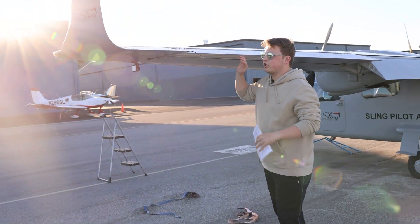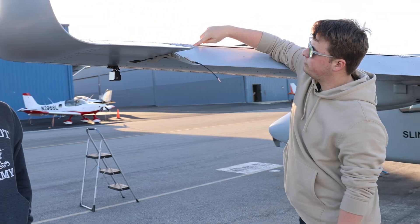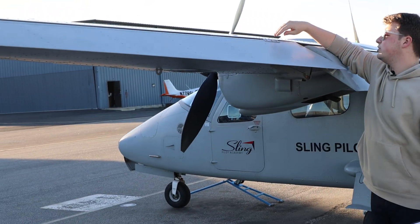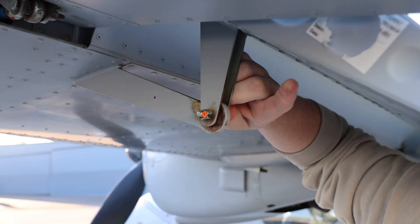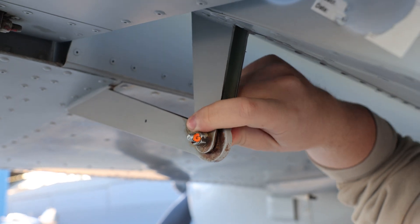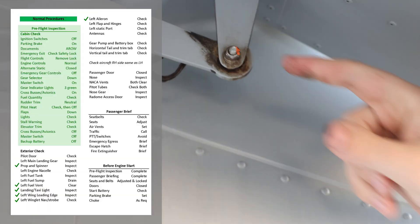Rolling on to the backside of the wing, we're going to check all the bolts and connections for our ailerons and our flaps. Moving these up and down — double-check everything's free, correct, no resistance to it. Also, for each of these hinges, there are little safety pins — you want to double-check that the safety pin's actually in there holding on your hinge. We got the outer one and our inner one. Ailerons checked. Next, the flaps — the whole reason we put the flaps down during the interior pre-flight is so we can hop under and check the bolts. We're going to make sure the torque seal is there, the bolt looks fine, and that we can see threading. There are three bolts total — checking each one for thread and torque seal. All good.